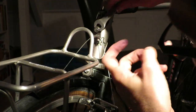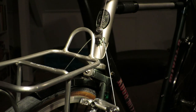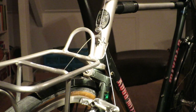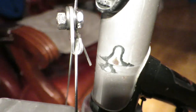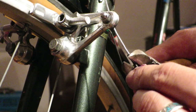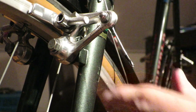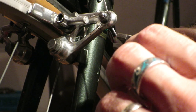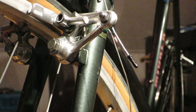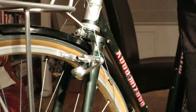I don't really have any specific advice on fine tuning, only that I make sure both the front and rear brakes have the exact same cable length so it looks nice. I also like my brakes to be rather tight on the rims. The cable goes right through the cable yoke, then one more cut, I put on the crimp, and the process is finished. I hope you liked the video — be sure to give it a like, and I hope to see you in the next video. Thanks for watching!